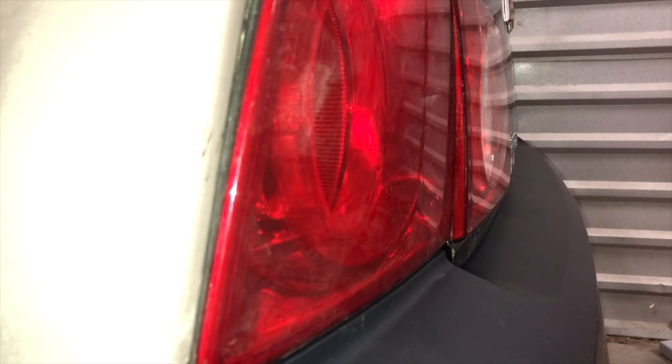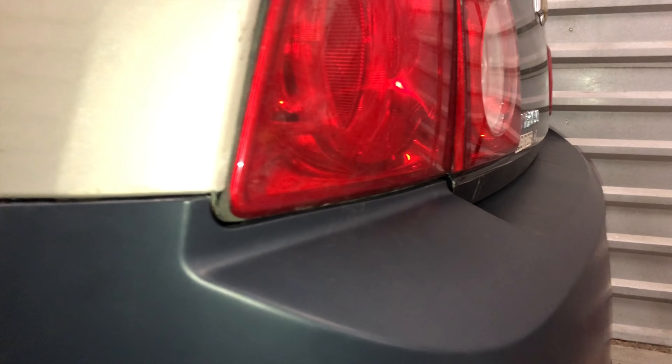This piece of the bumper was clipping in on the inside — I don't know if it broke on the other piece — but since it's still been in, I can't get the last three clip pieces to clip on tight. This whole corner is uneasy, but this side is easy. Y'all gonna see that this ain't clipping. Try one more time without putting too much force on it — this thing was probably bent. I could get a heat gun and warm it up while it's on the car and let it get that mold back. But for the most part it's there — I'm gonna try to work something out because that's ugly.